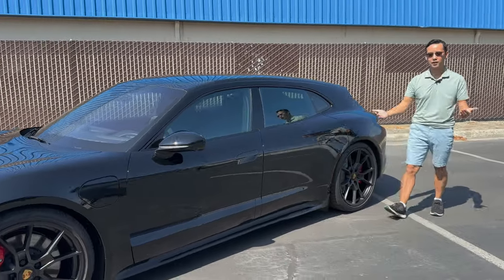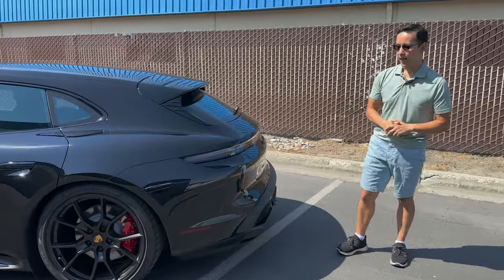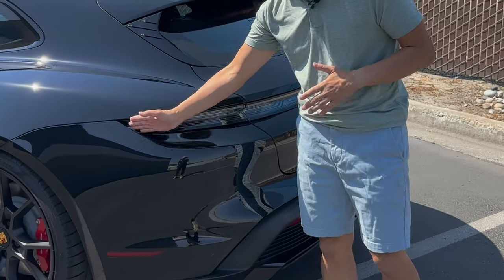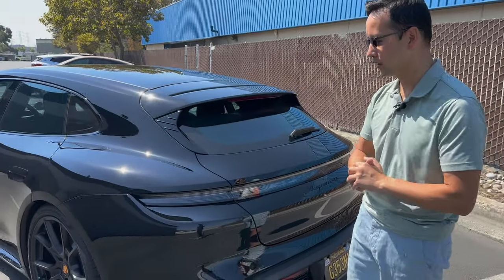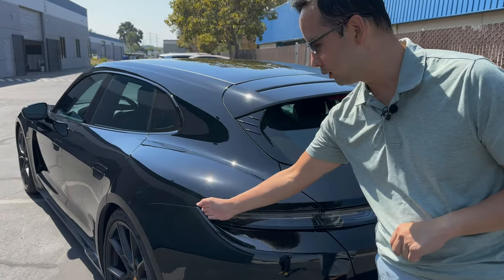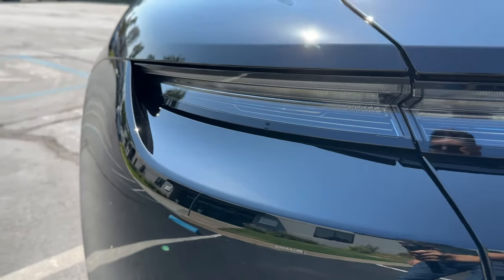Now, let's make our way to the back side of the car, where another difficult panel is the rear bumper. That is so because of this particular area where the panel has a really deep curve right by the rear tail lights. And what we do here, again, is fold the film in without having to open up the film, exposing bare paint. That's what normally happens if it is a pre-cut template.